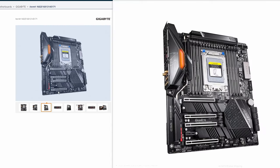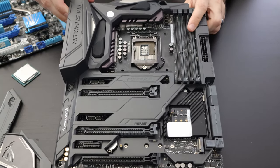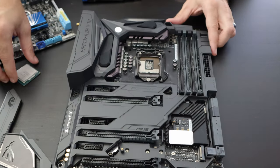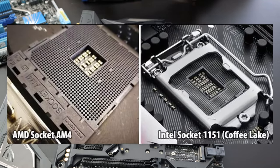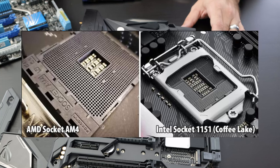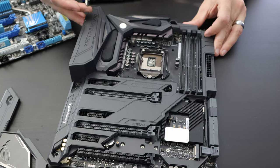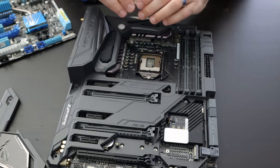You will need a much larger case to fit an Extended ATX board. So depending on the case you choose, you may have to buy a smaller motherboard — make sure that the motherboard fits the case and vice versa. That's very important. The first and probably most important component of the motherboard is going to be the CPU socket — where your CPU, or central processing unit, goes. We're just going to keep it real simple for now.